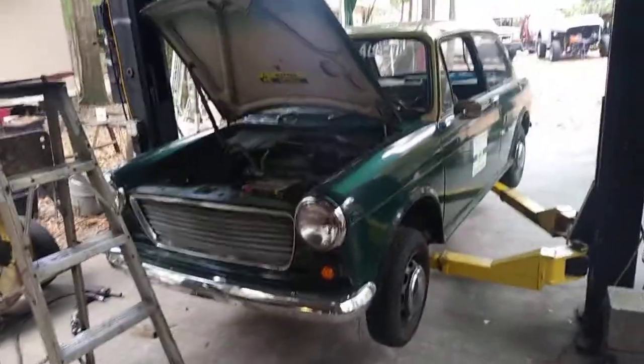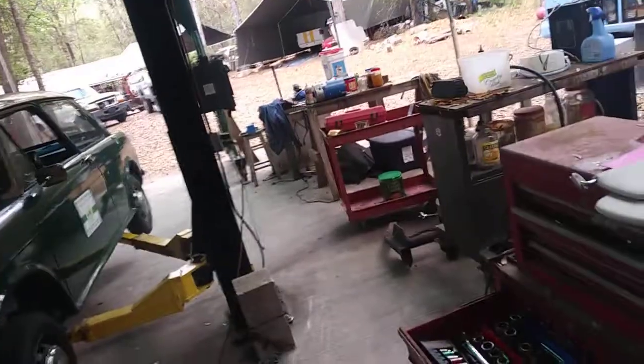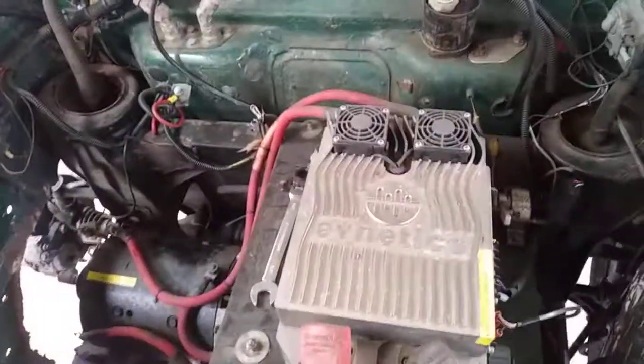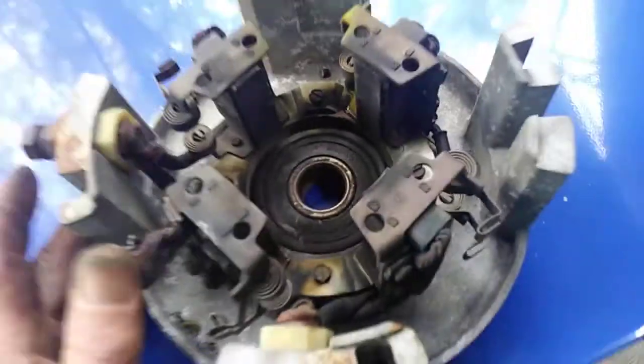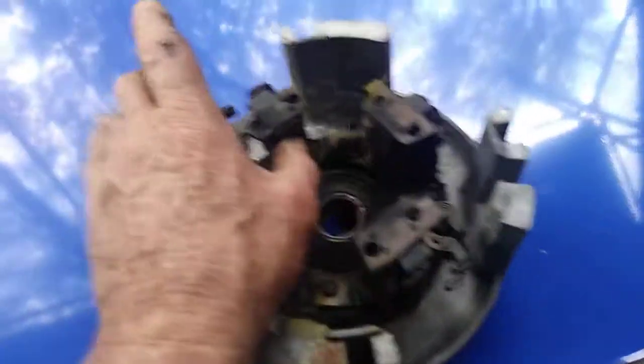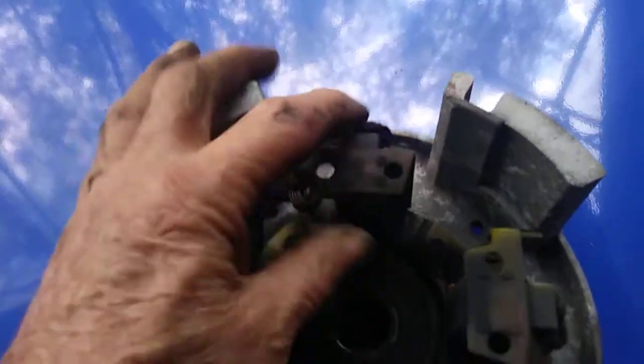This is Audrey's little car. The other day we had a bit of a hiccup while accelerating, so I decided to check into it. Sure enough, we have the problem that usually happens with motors that have sat for a long time. This is a little strange because it has been used, but the brushes — possibly due to high humidity here — are frozen in the holder.